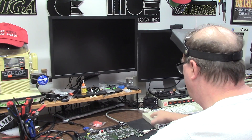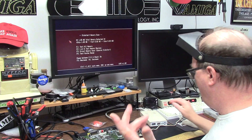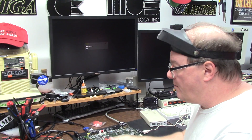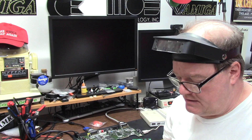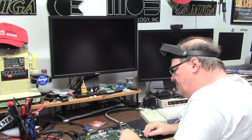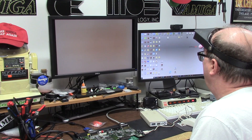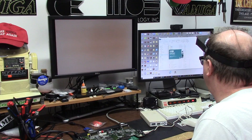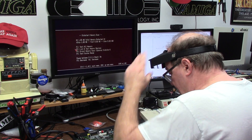Fire this up again with Amiga Test Kit in your belly. ATK memory says of course one meg. I want to test this new one — normally I take a pencil eraser and wipe over the contacts, but we'll use Hooper's Hooch — 99% isopropyl. I'm going to fire up the documentation for the A600 and look at the address lines. Memory: 1 meg. Well, why would it go bad? One of these little resistors might have blown.